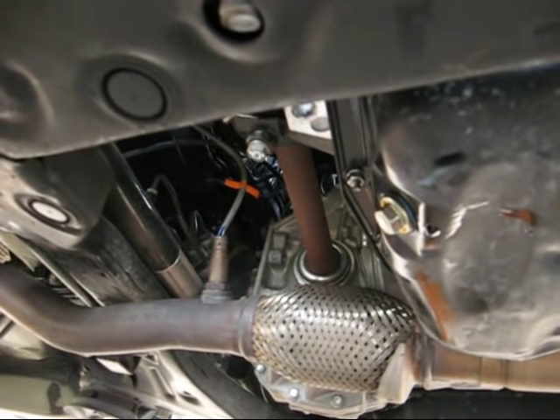We've put two quarts in already and I can't remember the total, so I'm going to look at the owner's manual. On page 489 it talks about oil capacity — drain and refill with filter. We have a small four-cylinder engine and it takes 4.7 quarts. Let me just finish putting it all in, and then we're going to start the car, let it run, and look underneath to see if it leaks. If it doesn't leak, I always put a little tag here to tell me when I changed the oil — or you can write it in your manual. Now that we've put all the oil in, make sure you put the cap on. We'll check the dipstick just for the fun of it — it's all the way up, so now let's start the car and see what it looks like.